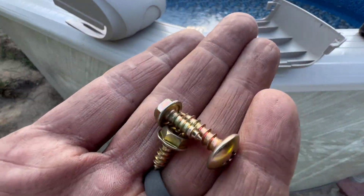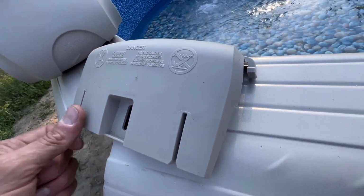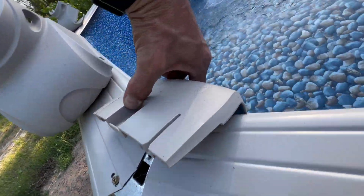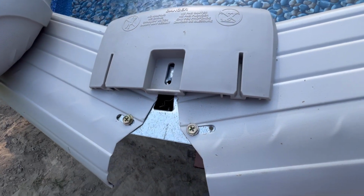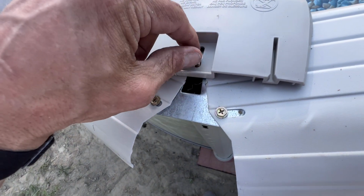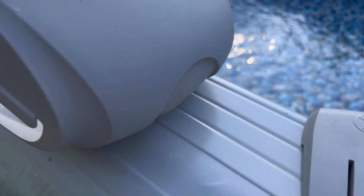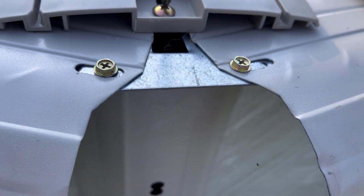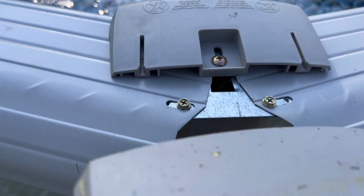But now, you need a 1 inch and 2 1/2 inch. Got those little hooks there. Those little hooks, you grab up under, and your hole's exposed. You put this screw in there. All right, so don't torque it down. It needs to be a little loose because this piece here has these edges that need to slide up under that. And so you don't want to crank it down, and then you can't get the outside piece of the clamshell on.